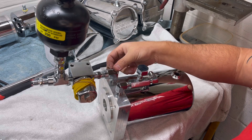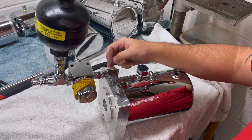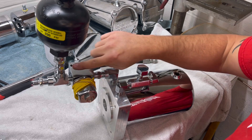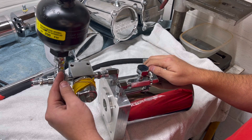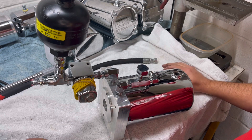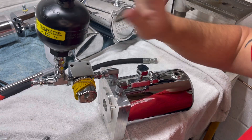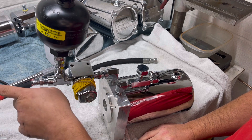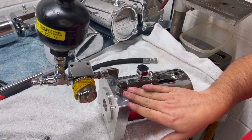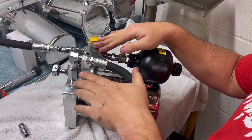In this particular case I have a 3/8 male 3/8 female 90-degree fitting. You've got your check valve right after that, then your dump where it goes through to a T fitting, and then connects to the accumulator right here. If you wanted to, you can put a shutoff valve on your accumulator, and then of course it goes to your fitting that goes out via hose to the cylinder itself, then you return through your slowdown back into the pump. This is on a single pump, single dump setup.